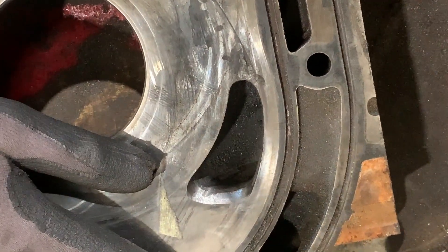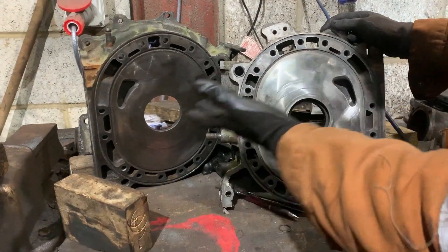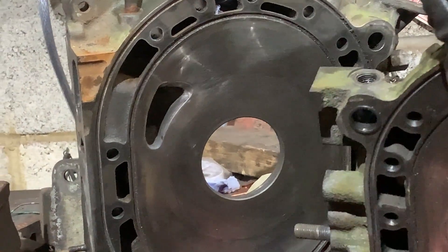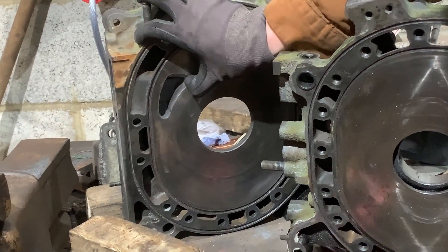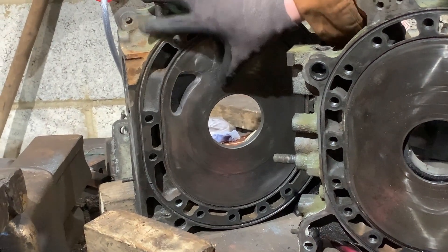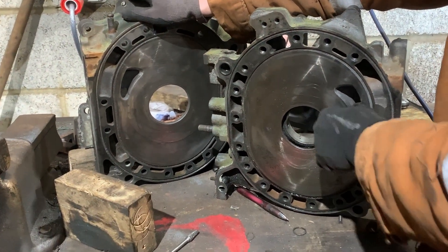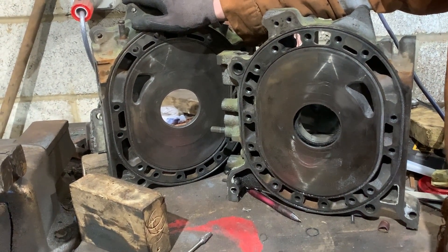Need to make sure that the other port looks the same. Both housings are done — they're really similar. I made a mistake where one of these bits flew out and landed there. Hopefully it's not too bad. I've sanded it down so it's smooth — it's a tiny mark. Unfortunately it's on the path of one of the seals, but I polished it up. Can't do much about it now but it's not as bad as it looks. I actually need to finish a little bit here because there's a small lip. This one's all good. Just going to clean them all up and start assembling the engine in the next video.